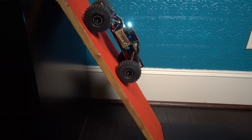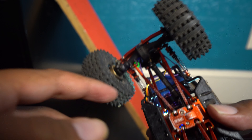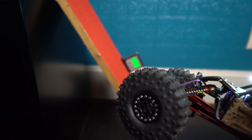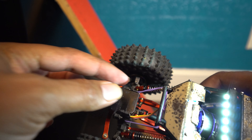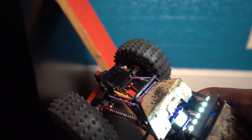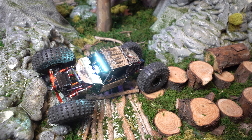One thing with this Fat Viper motor is it's very large, and with the long extended drive shafts, if it gets too low I have to run stiff suspension — otherwise the motor rubs the drive shaft. That's an easy fix as long as you're running stiff suspension to keep the shaft from touching the motor. But if I were to make the limiting strap tighter, it would bring the shaft closer to the motor and it would rub. I know I can get more than 62 degrees here, but because of that issue I can't tighten the limiting strap more in this situation.